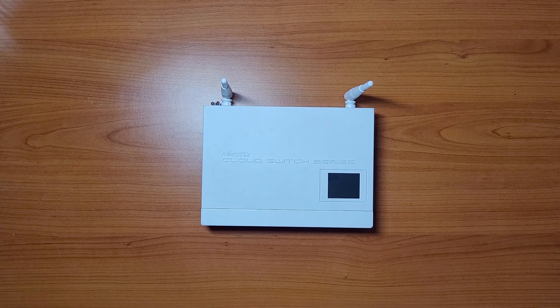Let's briefly talk about the Wi-Fi implementation. Even though it has Wi-Fi, it only has Wi-Fi 4 or 802.11n. This is a very old standard and it's starting to be deprecated on a lot of new devices, so I count it as one of the downsides of this switch. Also, the Wi-Fi antennas aren't really powerful and can cover only about three to four rooms before losing signal.